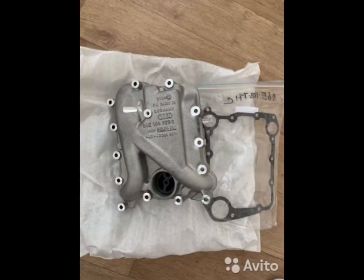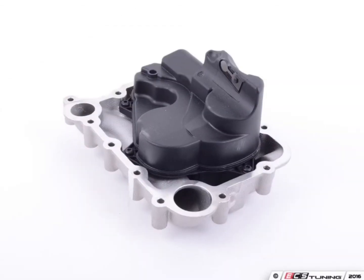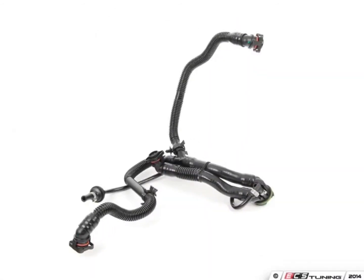Here's another thing — this is the metal PCV system from the older 3.2 FSI engine, a naturally aspirated early engine. I think it's 2005 or 2006 A4 or A6. First of all, it's metal. Second, it has metal gaskets, so you will never have coolant leaking into your PCV system. Many people have that issue because cooling has more pressure, and coolant getting into your engine can cause really bad damage. This valve requires a separate different spider hose and a JB Weld fitting. Also, this metal PCV requires 10mm longer bolts — the original bolts from the plastic PCV are too short. Make sure you get the different bolts.